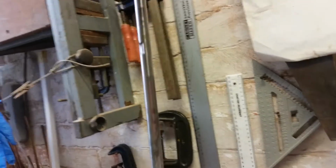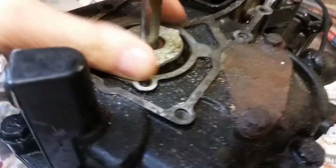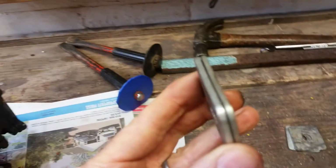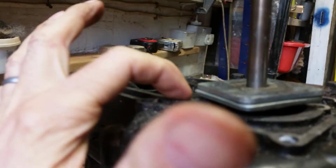Just where it goes is a bit like follows. A bunch of these washers drop over the end, so they're located here. Two really large thick washers. I needed two because, unbelievably, these started bending under the forces involved. These are, I hope you can see, clear of any surfaces here, because there's a gasket going to go there, so I don't want to damage that.